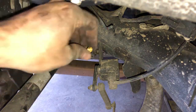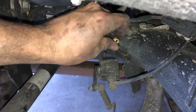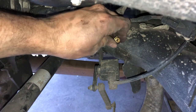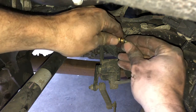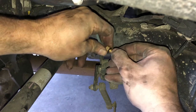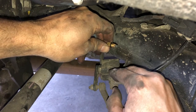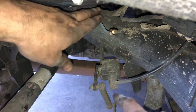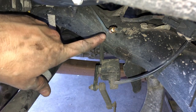I've got the new fitting — first of all I'm going to put the fitting on and then I'll put the collet on to keep the fitting on the airline. There we go, and we've just got a little bit of airline protruding the end there, that will be fine. So let's get the new air spring into the car. Be very careful not to cross-thread that.